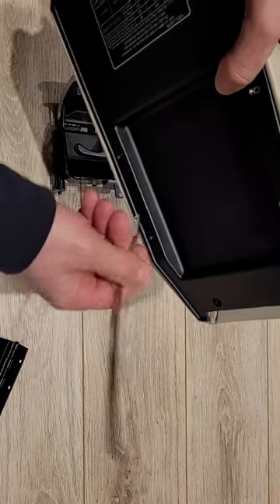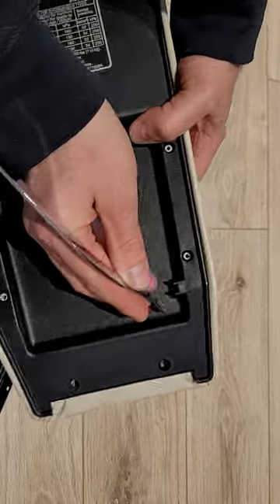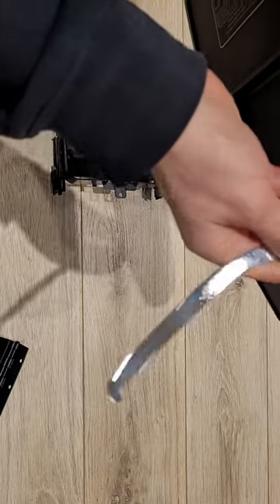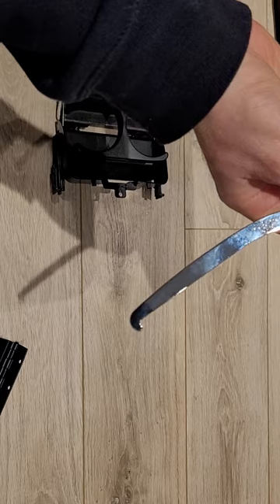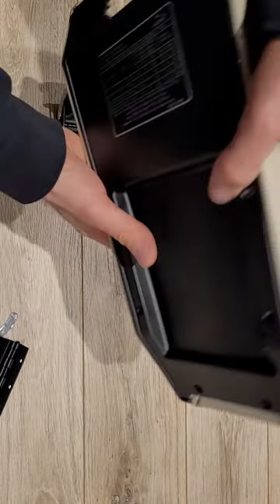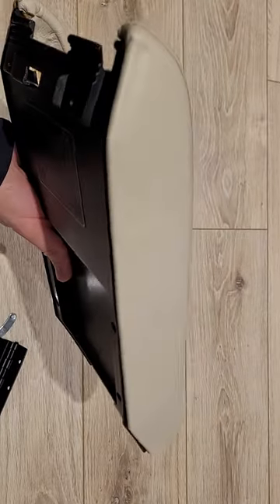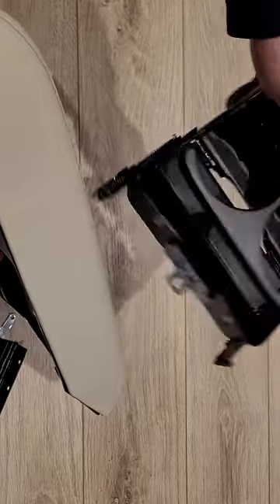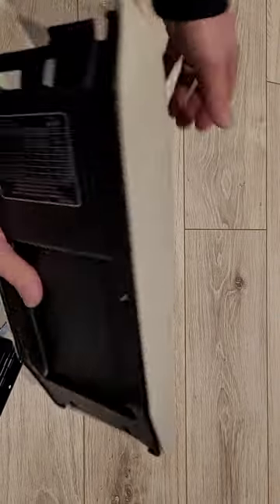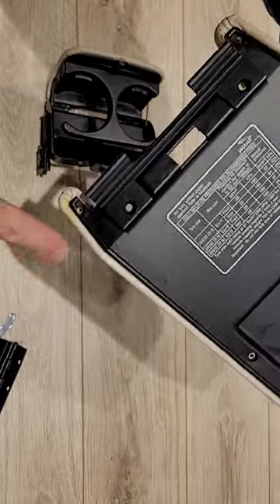There's also this little metal piece here which bolts onto here — the bottom of it is just a hook and it hooks into the central console, so you just pull it out. Once this comes off, you can then start your work on taking out the cup holders.